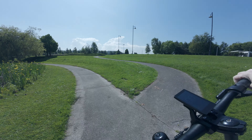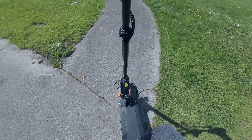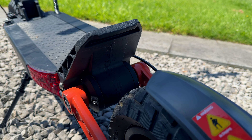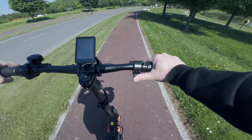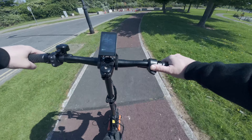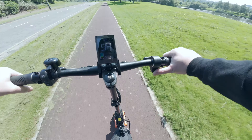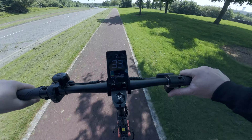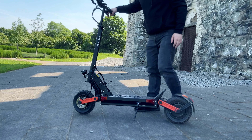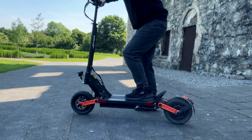This hill is a little bit steep — starting on dual motor gear 1, no problem at all. Gear 2 is actually really comfortable to ride. Taking a corner like this, the hybrid tires with their side tread give you more than enough cornering grip so you wouldn't slip out. It's designed quite well overall. The only concern is that slight wobble around 53–54 kilometers an hour. The suspension is maintenance-free but it's bushing suspension, so it's extremely firm.